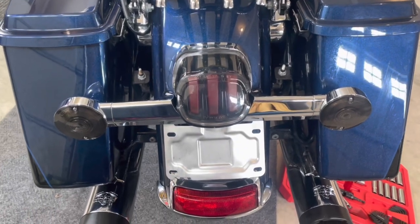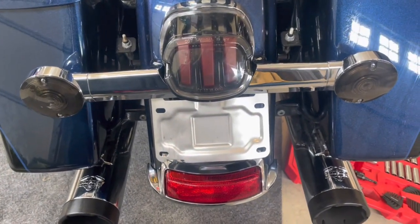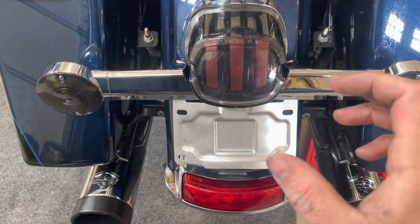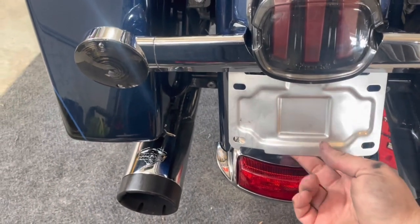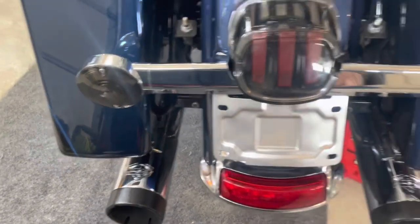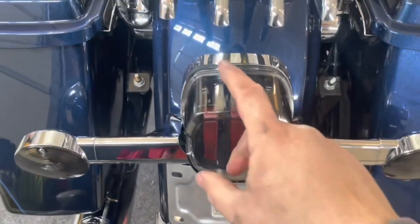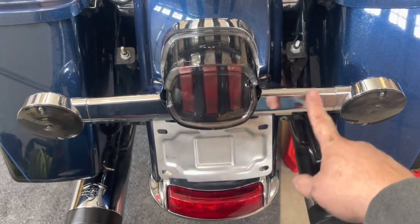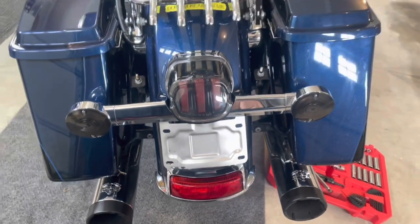She's done — really easy install, very basic. The only advice I'd give someone doing this for the first time: remember that foam pad on the back with the sticky side — don't peel that protective layer off before you get this positioned in place. It does stick really well, so keep it flexible, move it back a little bit, peel that off, and then adhere it to your bike. That's the only thing I'd do differently next time. I do realize I still have the light up top for the bracket; I am ordering a new tail light and bullet-style turn signals shortly. Until those arrive, this is what I've got — appreciate it and we'll see you next time.